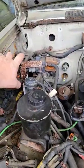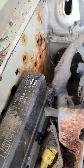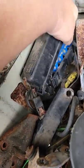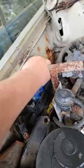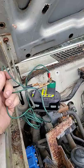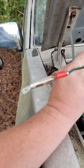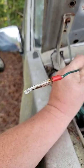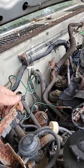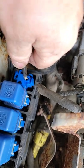Third step, you want to find the fuel pump relay. Just fire that right out of there all quick style. Then you get yourself a tool battery and affix some leads to it. Try to find a decent ground, maybe here. Then you take your connector and just start probing around till you find the right one.